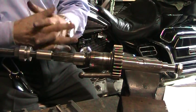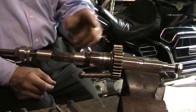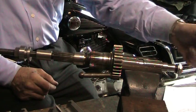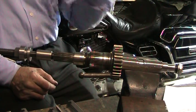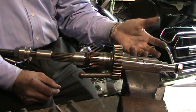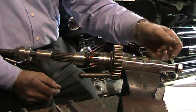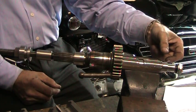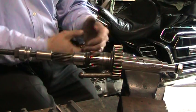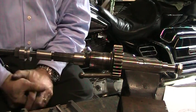It'll burn all the bearings, and that's not a good idea. The other method is to loosen the nut on the other side and push the shaft down so it'll clear, but then you'll have to remove the exhaust pipe. And it's a press fit, so you're really pulling on the nut to push it back into its position — that is not a good idea either.